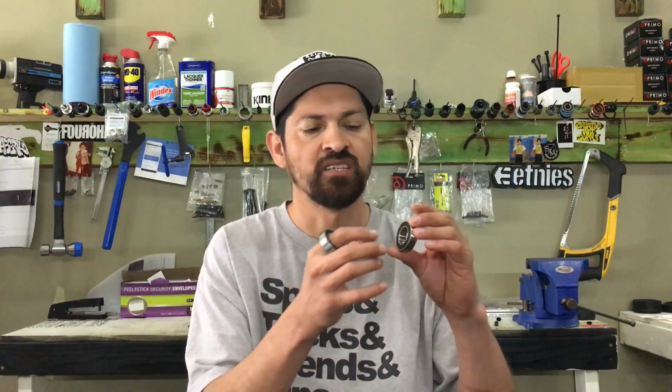We don't use them anymore. The other sizes are, there's a Spanish bottom bracket, which was created by a Spanish brand, and the bearing's actually a little bit smaller. When you run 22 millimeter cranks, it makes the bearings really small, and the bottom bracket tends to blow up. To be honest with you, every single person that I've ever seen with the Spanish bottom bracket and a 22 millimeter crank has blown up their bearings. The 19 ones last a little bit longer, but even those I've seen explode and end up failing. The bearings are just too small, so they didn't really make sense.